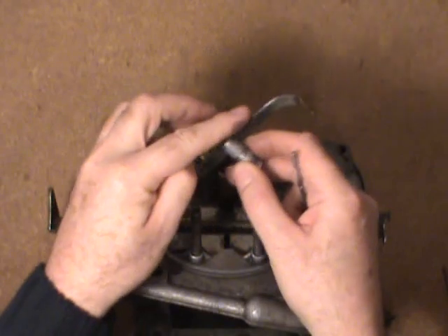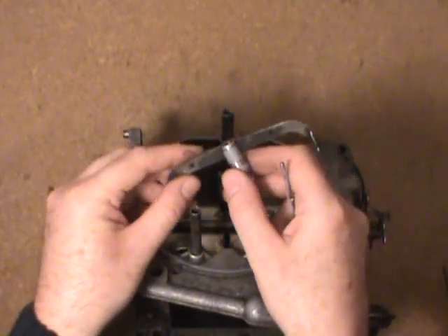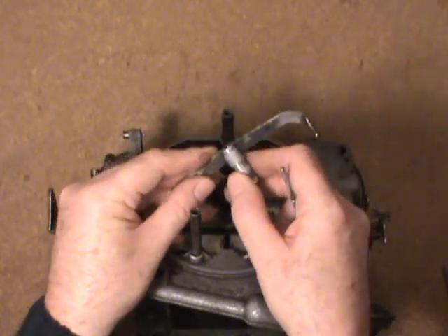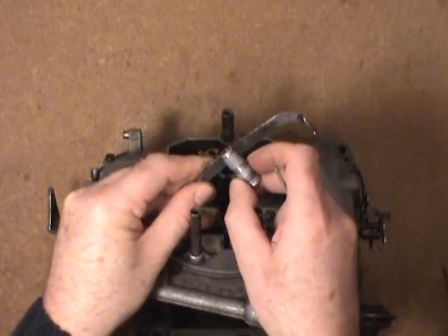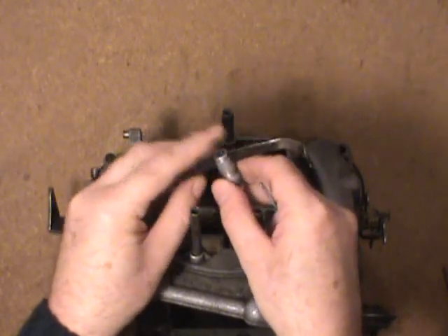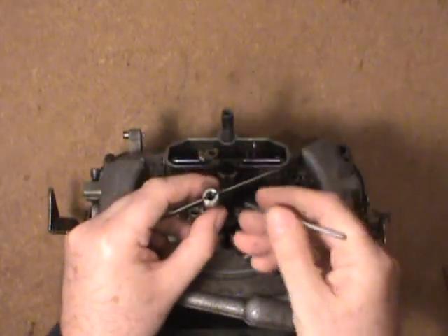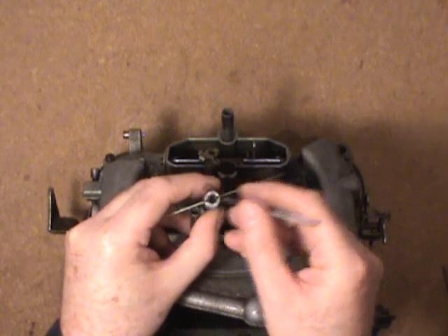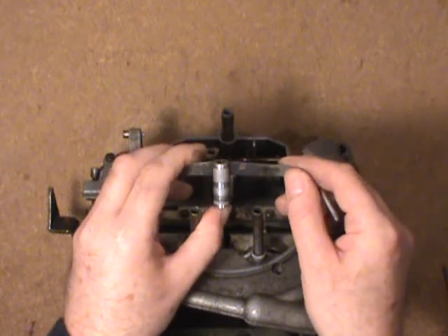One thing I noticed — when you're checking yours, it should be down tight against the piston. There's a slot in the piston. This is a one-piece steel tree, one branch out of each side. It's supposed to be pressed in there. This one, as you can see, it's wobbling — that's no good. What you need to do is sit this on a block of wood on the bottom, push this arm down tight, then get a small punch and a hammer and swage these ends over here to push the cross arm in nice and tight. You don't want it wobbling like that.